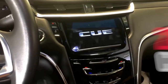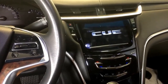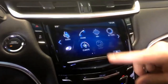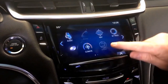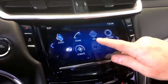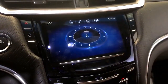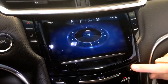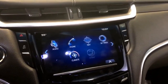You're here live with MVI today. We've got a 2013 Cadillac XTS and we're going to do a nav upgrade. As you can see, here's your basic CUE interface — this one is what's called IO5. What GM did is put a nav button here on the '13s, but when you push it it only goes to the compass. When we're all said and done, that'll actually have a map. This will work for 2013 through 2015 Cadillac XTS that didn't come with nav.